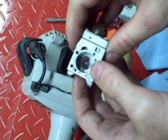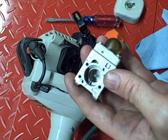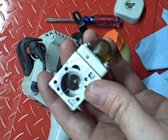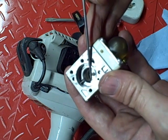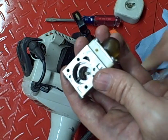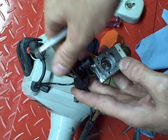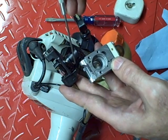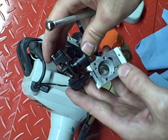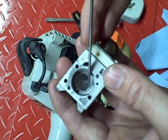The first thing you want to do is reinstall your throttle cable, but before you do that, there's a really important piece that's kind of hard to see. This little pin here — there's a round piece that fits over this pin, and your throttle valve right here has a ramp, and it rides on top of that piece. When it rotates, it pushes the throttle valve up, opening up this passageway for more fuel to come out.